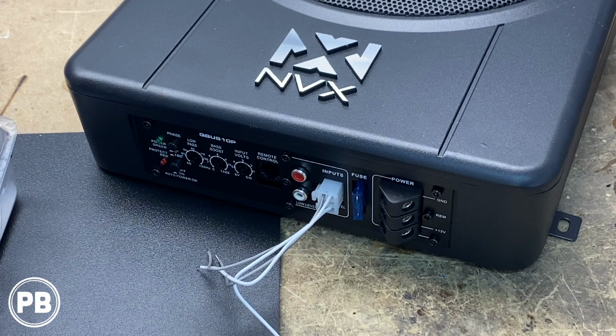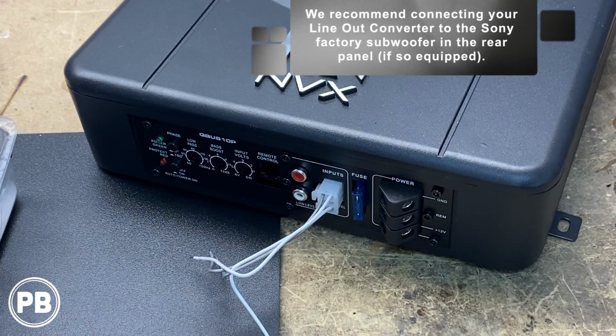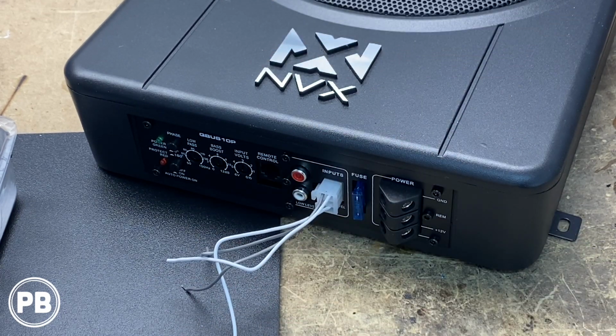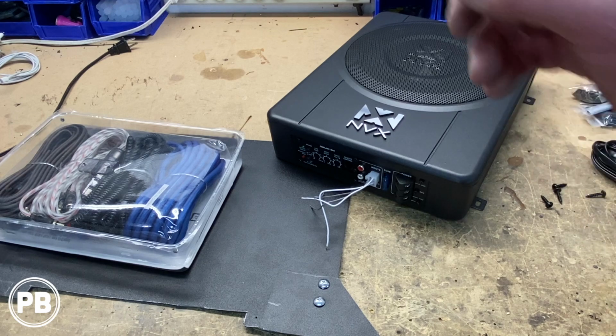Now, if you have the factory Sony sound system, you can't just go to any speaker, as that Sony amp is going to have some passive crossovers built into the amp. So alternatively, you'd probably need to run these to the factory subwoofer or use a high power line out converter for the factory sub, which we can link down in the description as well. So at this point, let's go ahead and pull our wiring kit apart.